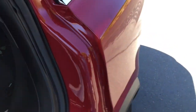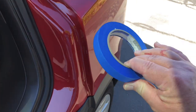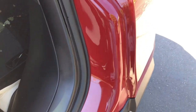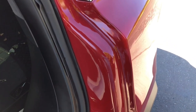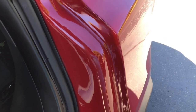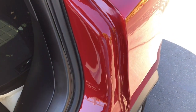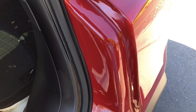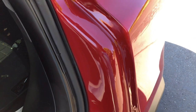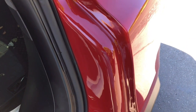What I'm going to do is use some blue tape and put a piece on each point where I see the scratches, then try to transfer that onto the door and see where on the door it's causing these scratches. Standby — there's the transfer. Now I'm going to transfer those tapes over onto the door.